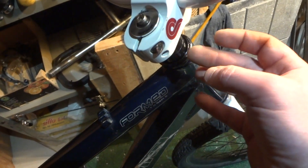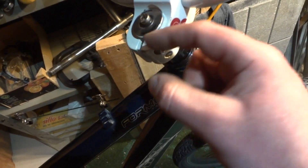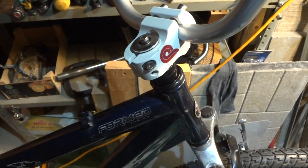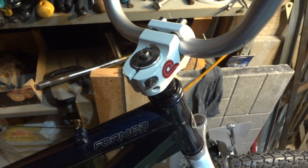They use a special fitting inside the fork shaft that's not actually welded — it's kind of pressed in. If you over-tighten that top screw you're going to mess up the little star nut that's in there. I'm going to make another video for threaded headsets. Thanks for watching, have a nice day!